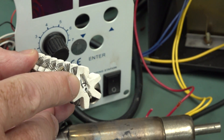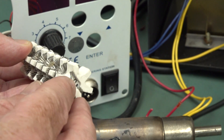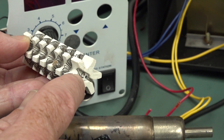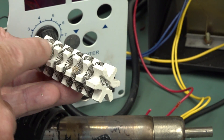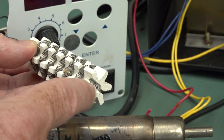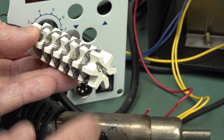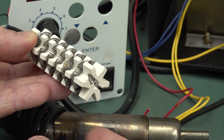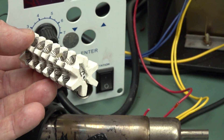One theory is that the fan blew, so there was no air blowing over the element anymore. There's a little thermistor in here that measures the temperature, and this is a ceramic insulator for the heating element. Because there was no air blowing over it anymore, the thermistor was detecting the wrong temperature and it kept pumping in power. But it's kind of near enough to still get radiant heat there — it's all covered in metal — so I don't think that was a real issue.